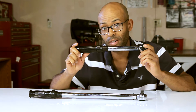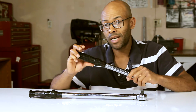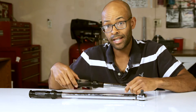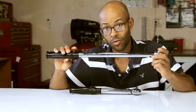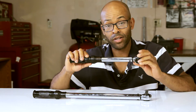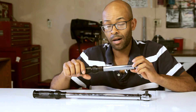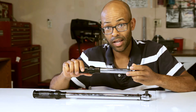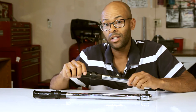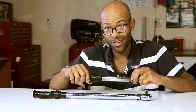You might also have to buy a smaller torque wrench that reads in inch-pounds and Newton meters. The reason for inch-pounds is that sometimes you'll have a torque specification that's lower than the lowest measurement on your large torque wrench, so you'll need a separate wrench that reads in inch-pounds. If you're thinking there's no foot-pounds reading, not a problem — just grab your calculator and convert inch-pounds into foot-pounds. If you don't have a calculator but you have internet, you can find a converter online. I'll put a link in the description below.